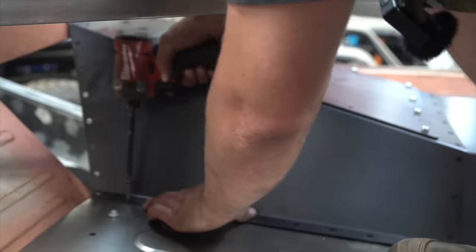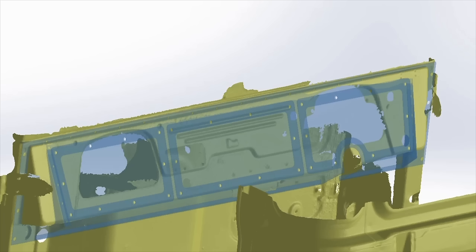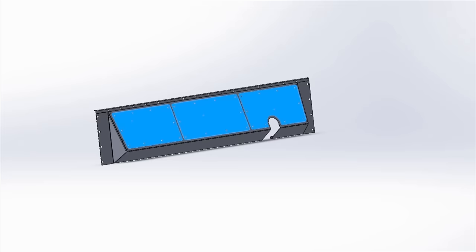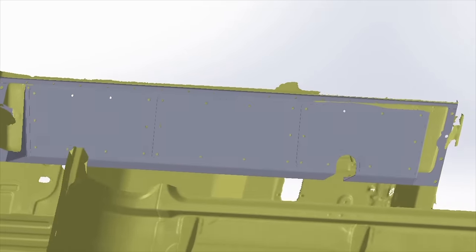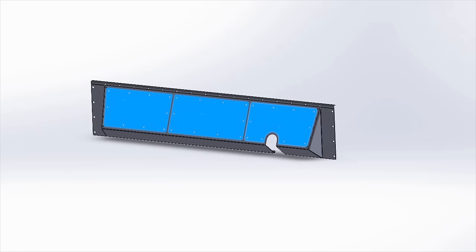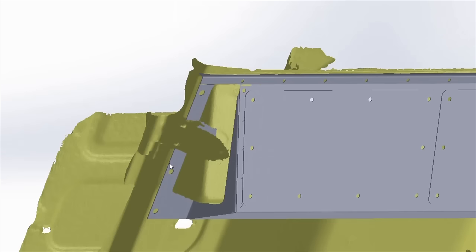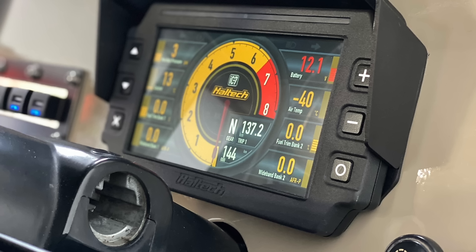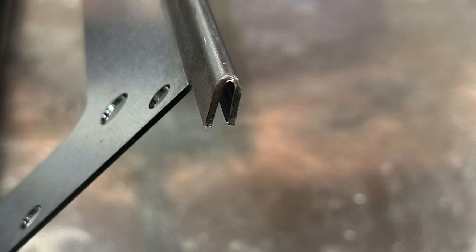The floors will get braced later once we've confirmed the engine and transmission position, but for now they're looking pretty good. With all the computers and screens we're using for this build, we've opted for a more race car inspired dash layout. This dash was designed using 3D scan data and features three removable panels which make for easy access to the computers and wiring which will eventually be mounted behind. This dash is narrower than the standard one to accommodate for the roll cage windscreen pillars. The panels will get cutouts in them for all the screens and switches but for now we're just leaving them blank. The dash comes off the CNC press brake with a hem which hooks over the exposed sheet metal in the cab.